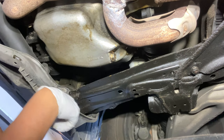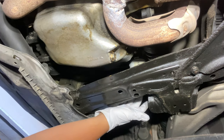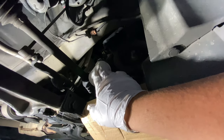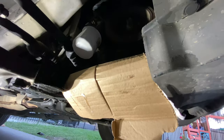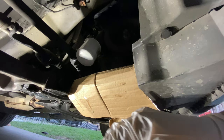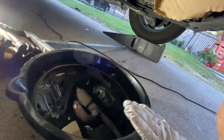Now we're going to want to go ahead and tighten it here. Good. And now we're going to go to the side where the oil filter is at. The oil filter is right here — this white part right here. I went ahead and put some cardboard here so when we take off the filter and it starts leaking oil, it won't leave a big mess on the frame. All of the oil will just fall straight into the oil pan, which I placed right under.